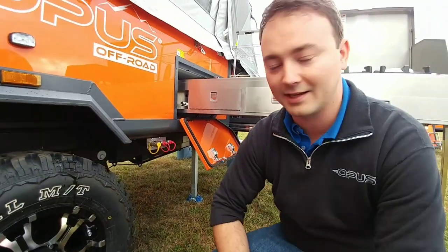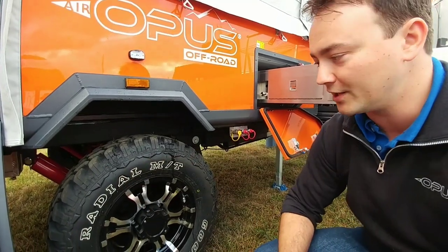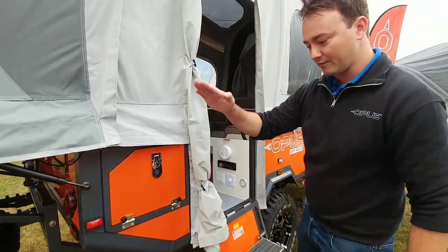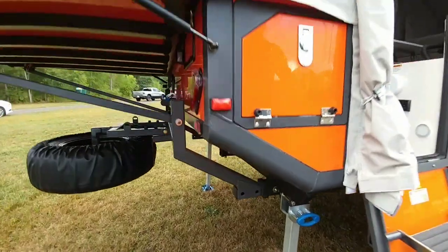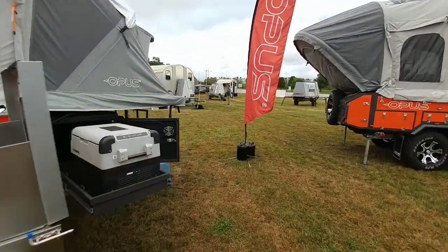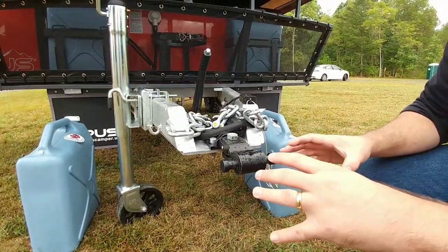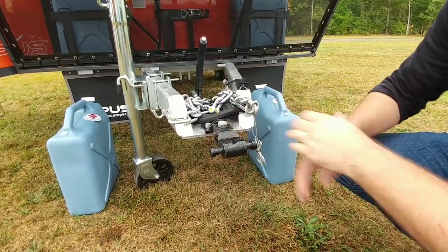It is independently articulating suspension. What that'll do is pivot left and right but keep the vehicle as steady as possible behind your tow vehicle. Then at the back here we've got this rear departure angle cut-out, so as this is articulating over rough terrain, this back end isn't going to scrape against the mud. It comes with a big standard off-road mud tire as a spare. And over on the front, what we've got is a lock and roll articulating hitch — this is the trailer side, it pivots left and right, and you've got 360-degree control on this hitch.